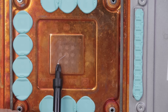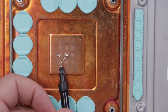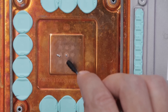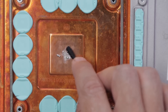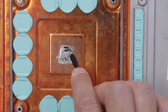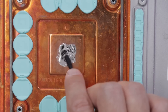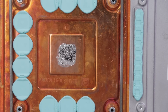I'm going to dab a little bit right in the middle — that is definitely too much. No problem though, we can suck it right back up. And now I'm just going to use the applicator that came with the liquid metal to spread it all around, just spreading it where it's going to be contacting the APU. That looks good — now let's get to that APU.